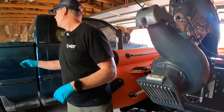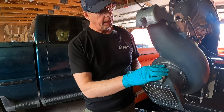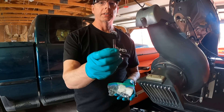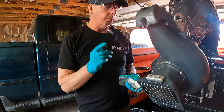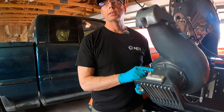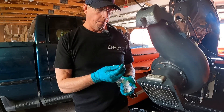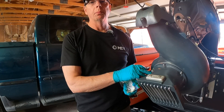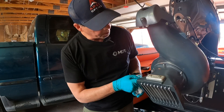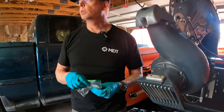Once I get the foot off, I have to take these studs out and replace them with the longer studs. I've talked to two different people — one said they're easy to come out, the other said they can be a real pain to get out. I'm going to try to double-nut them and remove them. One guy said just use vice grips, but I'd like to save them, so let's see how that goes.